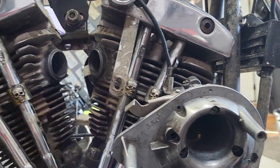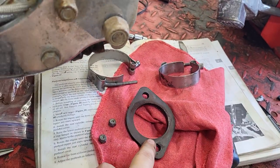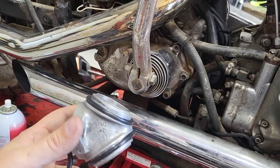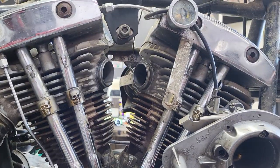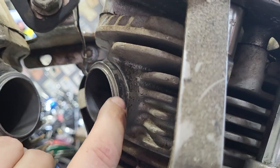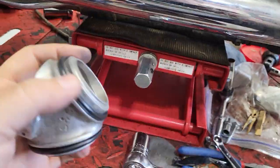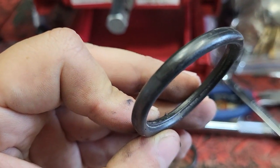I've already taken this apart. It has an S&S carburetor. You loosen it from the bracket, take the two bolts out of the back, set it off to the side, set your spacer gasket off to the side. If you have a Keihin carburetor it's not going to be S&S, but it has a similar manifold with the exact same intake seals. Once you've got it off, come in with a wire brush and clean off everyone else's work from the last 40-some years.